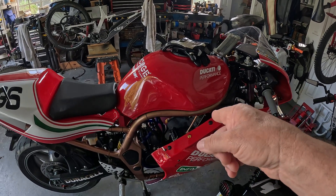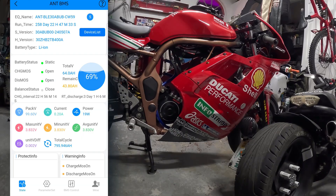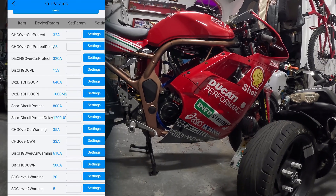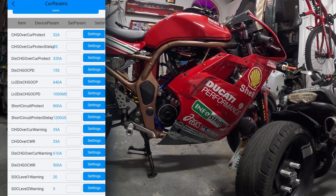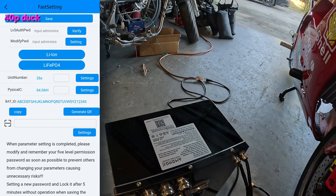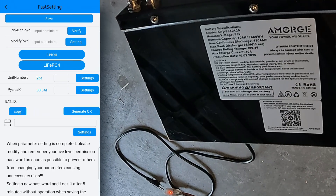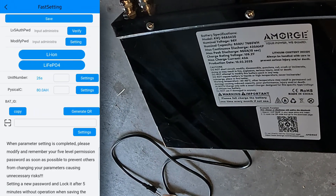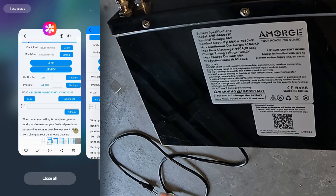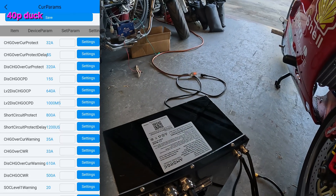I know I can't overstress the new battery with these settings, so I'm going to run it and see if I improve. I will need to set my BMS up on the new battery the same as the BMS on the old battery, so I'm not limiting myself without realizing it or giving myself more power unfairly during the comparison. I can adjust the BMS later after this test when I tune the bike. I've plugged my charger in so I can Bluetooth to the new battery — I'm wanting to mimic exactly what I had on the other battery: 26S 64Ah old versus 26S 80Ah new. These two batteries are the exact same physical size and the exact same number of cells; the only difference I'm testing is the cell type — 40P versus 50PL.